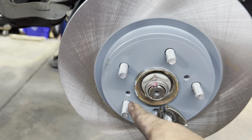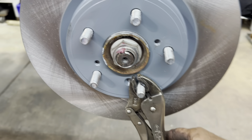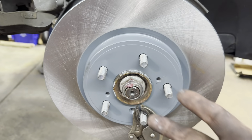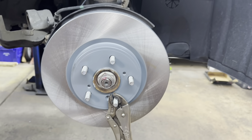If you've got new retainer screws, go ahead and put those in. If you don't, just use a pair of vice grips on there lightly to keep the rotor from flopping around. Once you've got the tire on and the caliper bracket, it'll push it up nice and flat.